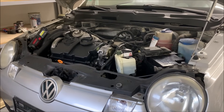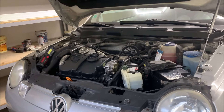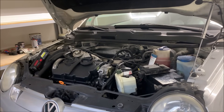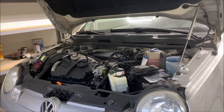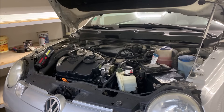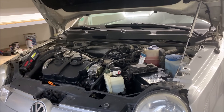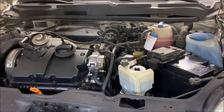The program could run through, but I couldn't really reach the final position in the final step. I was lying underneath the car, wiggled the gear selector, and then it worked — the program ran through. But something is still not exactly where it should be. I can start the engine again, which is good because the gearbox also prevents you from starting the engine if it's not set up correctly. However, as soon as I'm in D or R it doesn't allow me to use the throttle anymore, and there's still no error code.